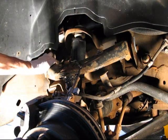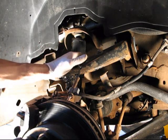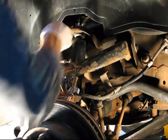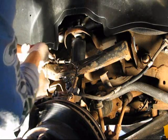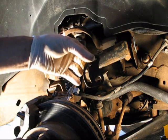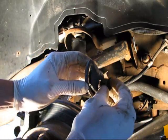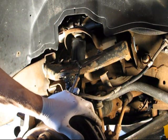We loosened up these 21 millimeter bolts that hold the stock upper control arm. You take them out and there are little eccentrics here that you have to make sure you take out along with it. Let me show you what that looks like — that's what the eccentric looks like. They go back in with the stock hardware and stock keys. There's a little nipple on there that fits and slides up and down, and it'll slide right on there and attach. We'll take out the other side, get this stock control arm out, and get the Cognito arm in.